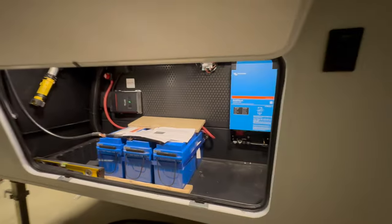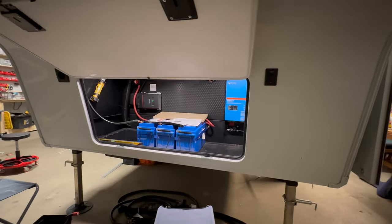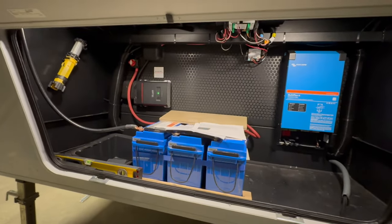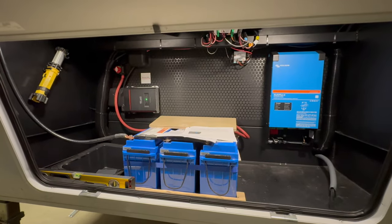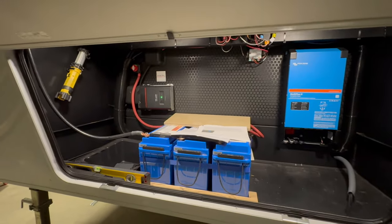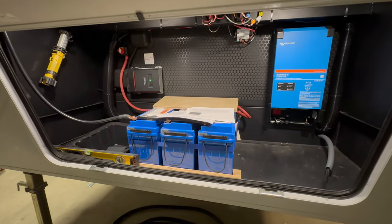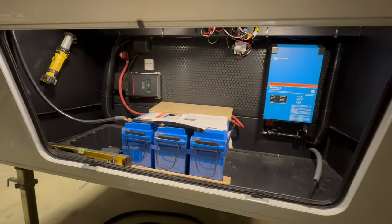So what we're thinking about doing there, for those of you at home, is adding more solar to this. This comes with 370 watts standard, but the customer here has two other panels. So whatever 370 times three is, that math works out to more than 50 amps into the battery, but probably a little less than 100. So we're going to maybe do a 100 amp Victron controller to complement that. Is what we're thinking? Yep.